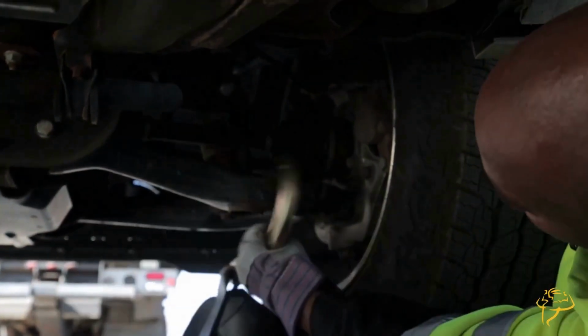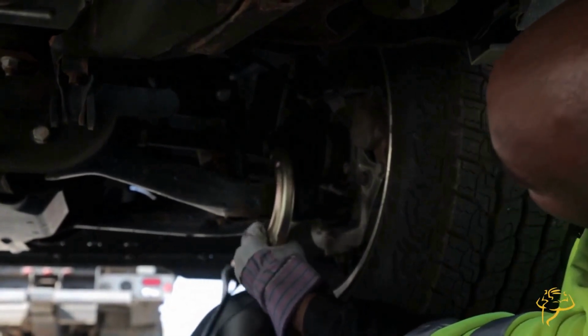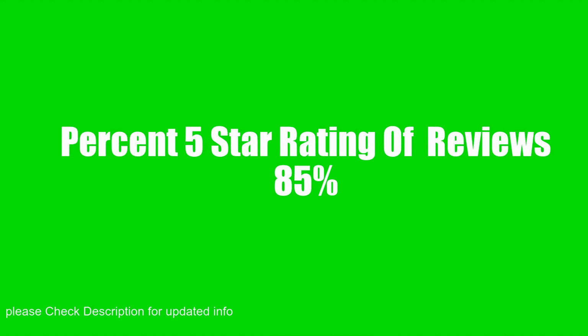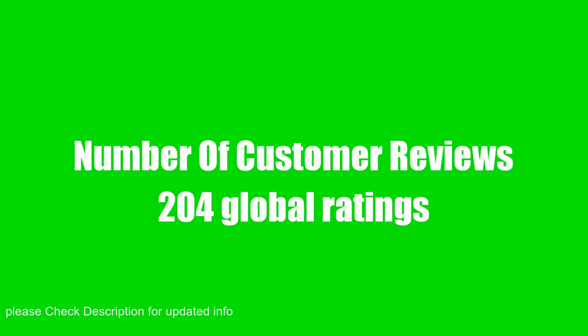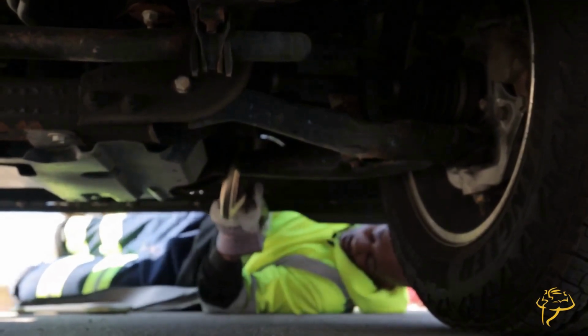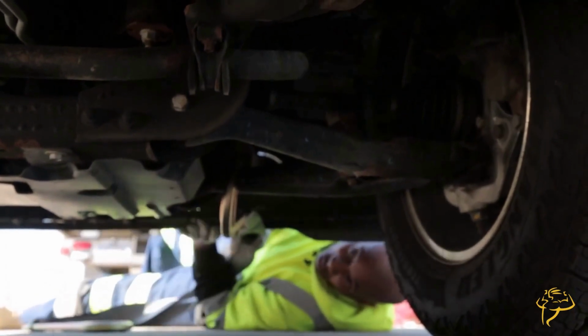That's too much. Here, still too close to the stabilizer pin and the axles, which causes more damage if you're going to hook it with this J. The safer way, right here at the front of the control arm. This strap is rated at over 5,000 pounds, which means there is plenty of room for the axle to clear from underneath the vehicle.